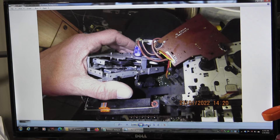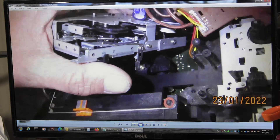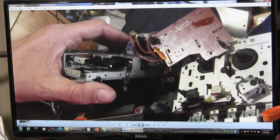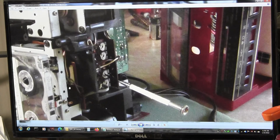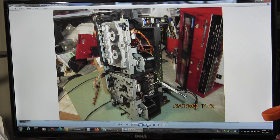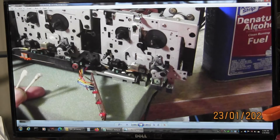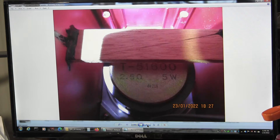On the first deck, my mistake was simply taking the top belt off and putting on another belt without removing the flywheel. I had to remove the panel to gain access to the wheel because you couldn't do it otherwise. There are four pots — two for high-speed dubbing, and the other two are for the motor speed adjustment: one for the lower deck and one for the upper deck. I cleaned the pots with denatured alcohol.